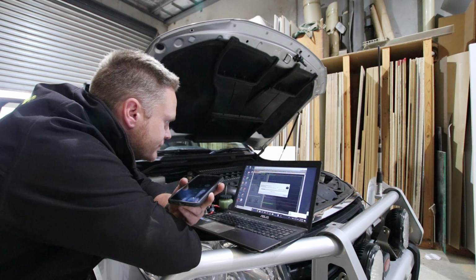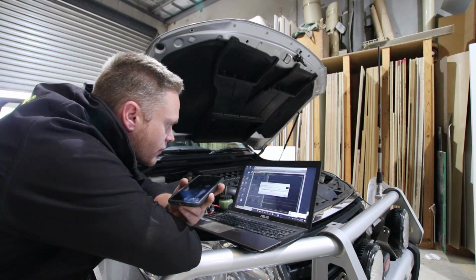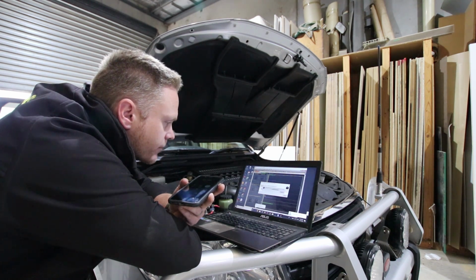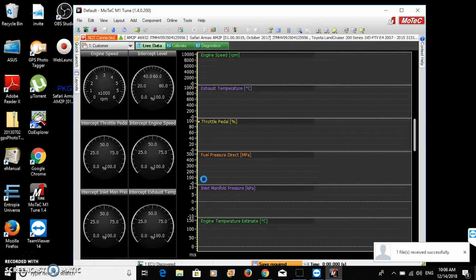All makes sense. If you took this off your car and put it into a stock standard car that didn't have the snorkel, didn't have the exhaust, it would have overfueling issues and be blowing black smoke. Yeah. So the difference now is I've got an exhaust, but before I didn't. What are the parameters that change from that?